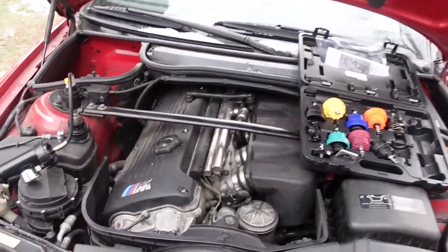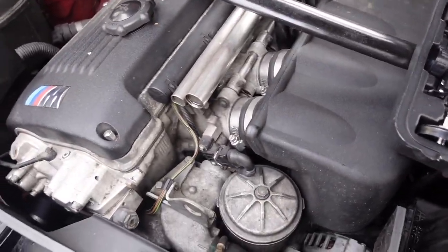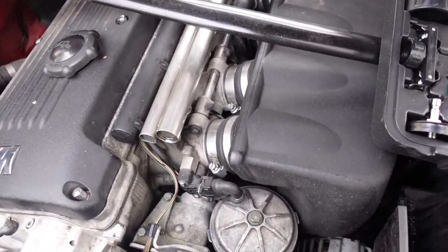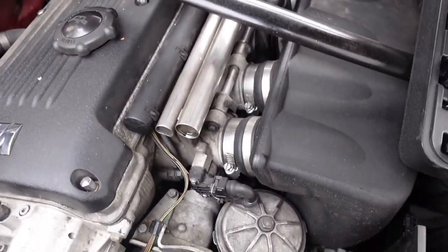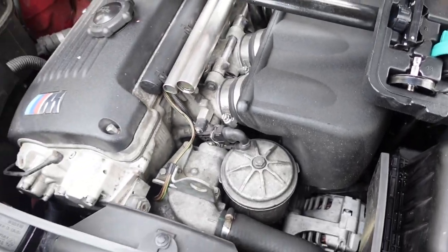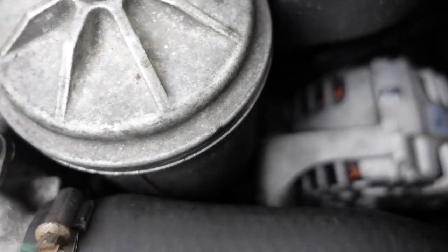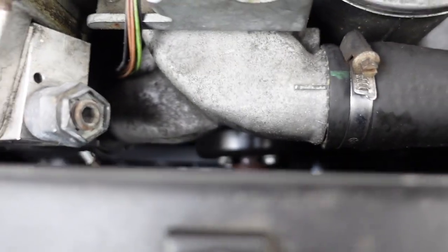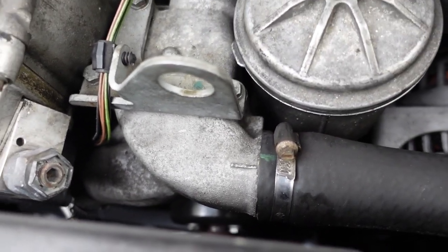And we're here today. My inference here, I didn't really diagnose it, but there was coolant all in the middle area here. I just started it, and this fan is actually hitting the shroud. And my inference was actually right. As you can see, guys, look at the water pump pulley. It's actually crooked.